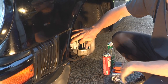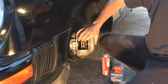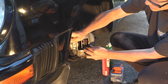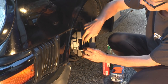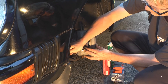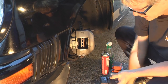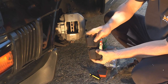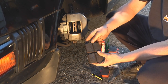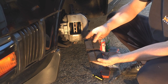Sometimes the pistons are stuck out a little farther and you have to pry them back, which is a bit of a pain. But with old pads you just need a little leverage — take a screwdriver and give it a little push. Look at all that crystallization on there — that's a lot of heat being generated. They still would have worked fine; they're doing their duty.